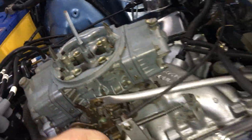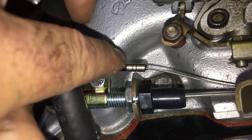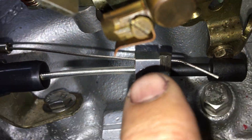Stepping back to the actuator setup: the actuator has got the throttle cable coming out of it, which goes off to your throttle linkage. I've just run that up and joined it to the existing throttle cable, running it all the way around. There's a mount setup that comes with the kit that mounts the existing throttle cable, and you just tie those two together — there's a bolt underneath and a little screw that joins it up to the existing throttle cable.